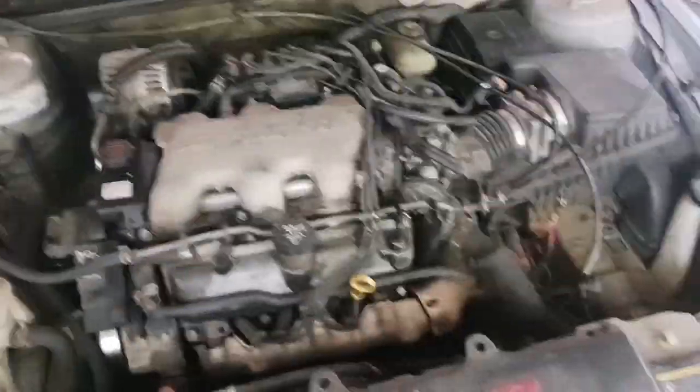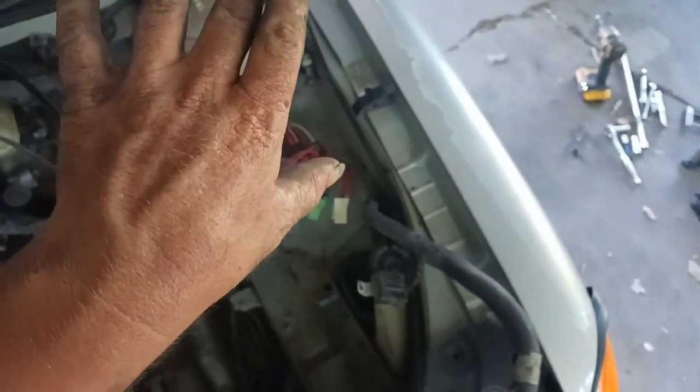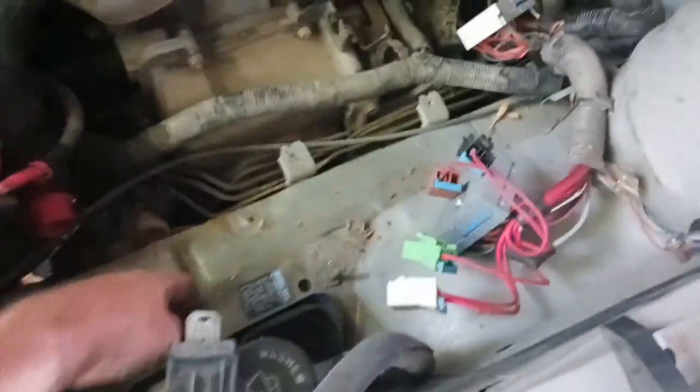Alright, I've made a little bit of progress. I've got the fuse box out, the air box out, the fuse box bracket, the battery tray, and the intake piece. I've got all the harnesses undone out of the fuse box. I went ahead and disconnected the shifter cable because the harness runs down and plugs into the transmission. There's also a ground right down there and a few other wires, plus up here to the ABS pump. I've got the washer fluid reservoir motor unplugged - it's got a couple plugs. Only took me about 20 minutes.